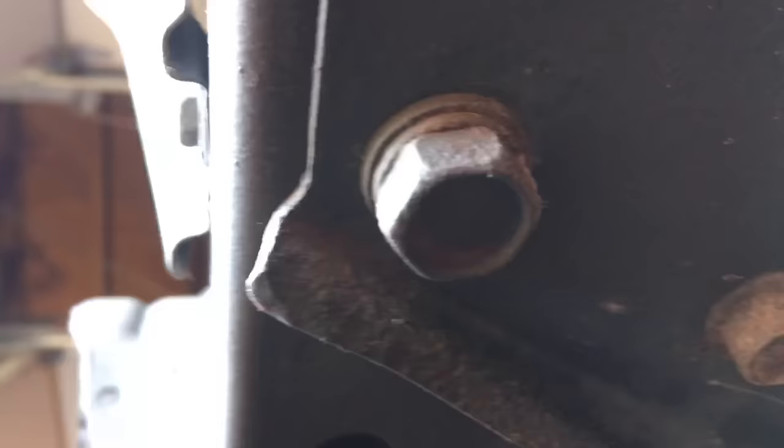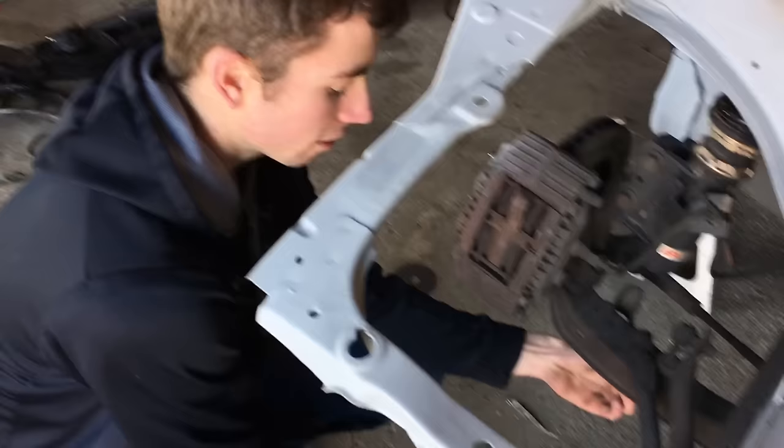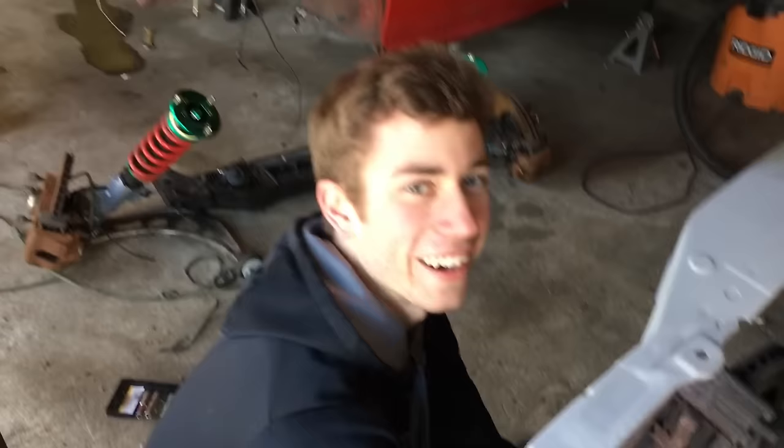So I'm about to roll under here. You've got your subframe bolts, sway bar bolts which are hard to see, and right here — you got those bolts too. I'm going to go ahead and knock all those out and lower it down on the jack. Now we're pulling the tension rods off. I was going to drop it all as one big piece, but I knew it was all coming apart anyway, so I'd rather do it piece by piece while it's on the car — because if you do it off the car, everything's going to be everywhere.